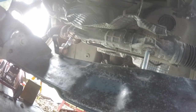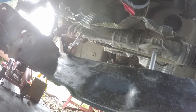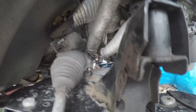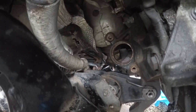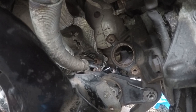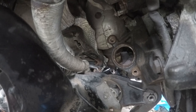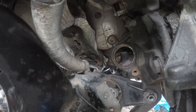You've got a clip there which clips in between these two, and there's another clip that goes just up there, clips into there, and you can wiggle this in place. So if we bend this back up, pop rivet them in, and bend that back down is the plan. You can just about see the bolts appear here and here — this is coming into line where we're going to pop rivet in. It might have been best to put them on when the subframe was out and screw them onto the pipes and then re-thread that bracket into the subframe when putting it in.